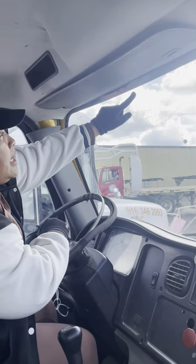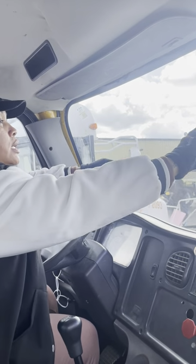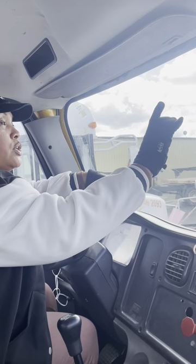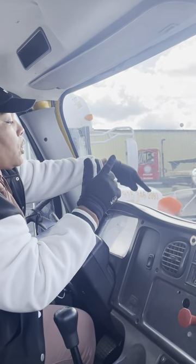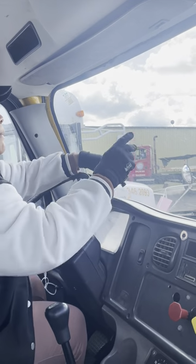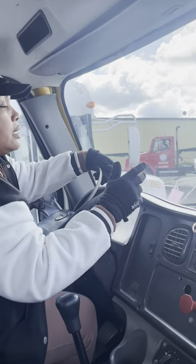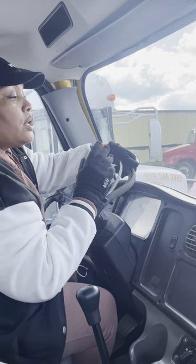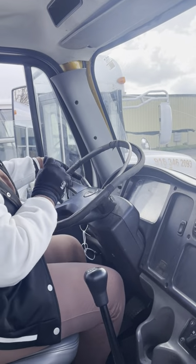Securely mounted, not leaking. My windshield, not cracked, broken, or damaged. Securely mounted. No illegal stickers and no obstructions on it. My windshield wiper arms, not bent and broken, not missing, securely mounted. My windshield wiper blades, no abrasions, bubbles, or cuts. They're soft and pliable. This is how I make them work, and the fluids too. You're going to push the button on the tip of the stick.